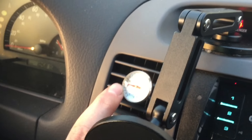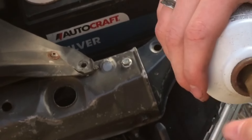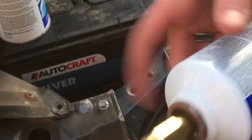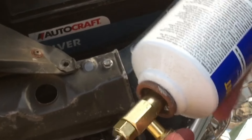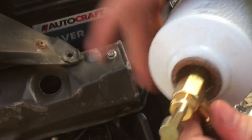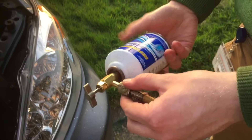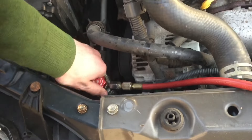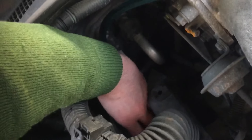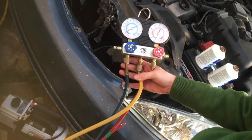Our temperature gauge is reading 40 degrees, so it's blowing cold air, and the outside temperature is 67. Now you'll have a can that you didn't use all the refrigerant in — you can unscrew this all the way back up. These new cans all have a Schrader valve on top, so it's safe to unscrew the can. It'll hiss out a little bit but then stop, and you can save all the refrigerant that's in there. Turn off the car. Close the high side, close the low side, pop it off, and disconnect. There's still a little bit of pressure in the gauges, so just open it to release. That's how you do a full recharge on an AC system that has no refrigerant at all.